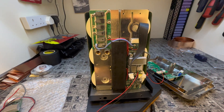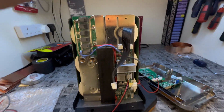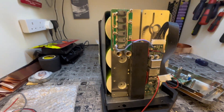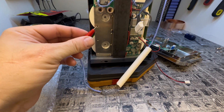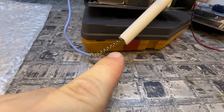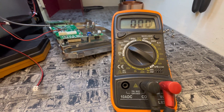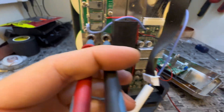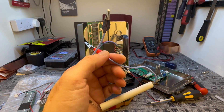The next stage is to discharge this unit using this tungsten wire. We're going to connect to the minus side up here and the plus side. Connect the minus, connect the plus — do not touch that because it's going to get hot. That's how you discharge the unit. Next, put your multimeter into DC voltage and check across these terminals. It's under one volt so it's safe to work on — the unit is discharged.